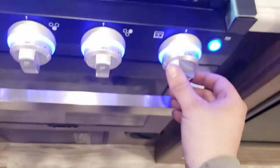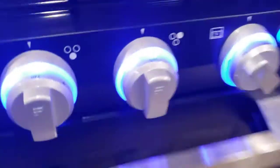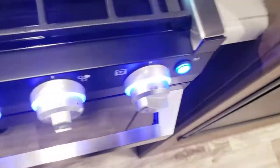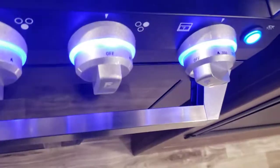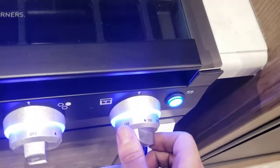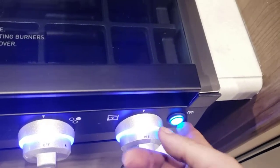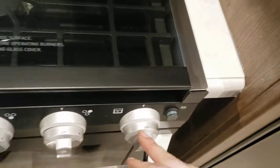The oven is a little different. Turn the knob to that little flame icon, push and hold, and as you're pushing and holding, twist your sparker — you're trying to get that pilot to light. Once the pilot is lit, you can set it to whatever temperature you want. If you plan on cooking again in a few hours and don't want to relight the pilot, turn the knob to the flame position when done — it shuts the burners off but leaves the pilot on. Turn it fully off before you go to bed; you don't want to leave the pilot on overnight.